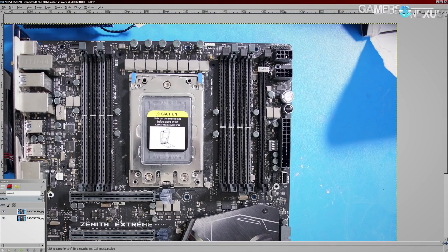Starting off in the top right corner, the board has two eight-pin power connectors for the CPU. Honestly for Threadripper I think this is ridiculous overkill, though AMD actually requires two eight-pin — like an eight-pin and a four-pin by specification — even though Threadripper doesn't pull as much power as Skylake X. So even with an overclock, as long as you weren't pushing it too hard, a Threadripper should get away with just one eight-pin without any real issues.